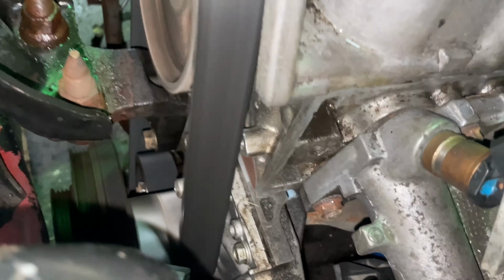But I made sure the firing order was correct. I made sure that the injectors were in the correct order. All that. It just doesn't run very smooth. Probably needs a distributor because it's an aftermarket distributor, and on Hondas, they don't like aftermarket distributors. But we're taking it home now. We got the Acura alignment today in a couple of minutes. So let's go get ready for that.